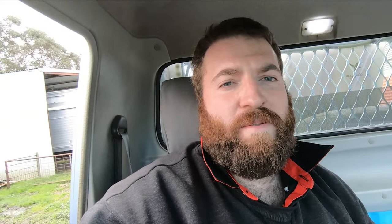I'm going to quickly jump under and check that there's actually power and earth and all that. I'm pretty sure it should be fine because it was still working, just not accurately. But I think it's going to be time to get a new sender unit for it. I'll quickly jump under and check that wiring.